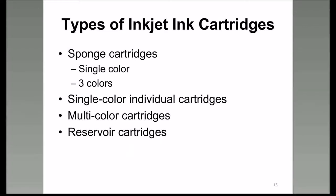When we talk about an inkjet ink cartridge, some cartridges have a single color or three colors in them, and all of them may have a sponge inside. This sponge is in there for a reason: as the printhead moves back and forth inside the printer at fast speed squirting ink out, you may get sloshing of the ink. The sponge keeps the ink from sloshing around.